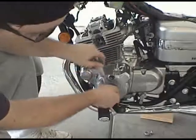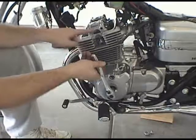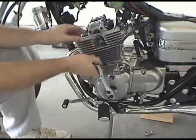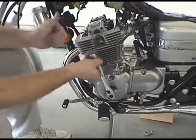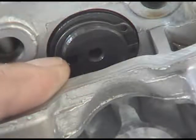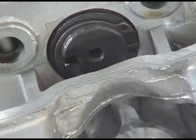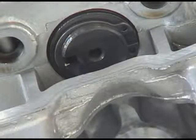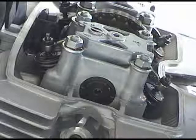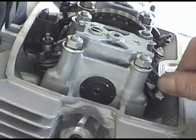This should allow a little more exhaust to flow out — at least that's what I'm thinking; I could be wrong on that. Time to do the other side. We have to spin the crankshaft one more time — 360 degrees — so that the pac-man notch comes one full circle. Our T mark reappears, but this time cylinder number two on the right side of the bike is at top dead center. The little indicator is now facing the opposite direction. We've verified the timing mark and now we'll go around to check the clearances on those valves.